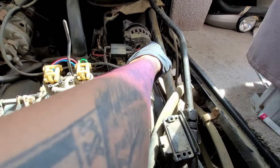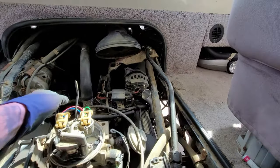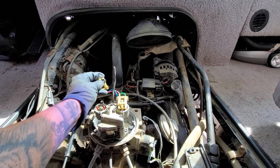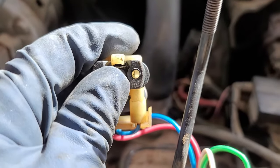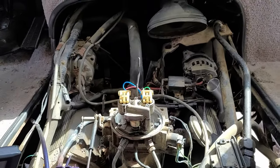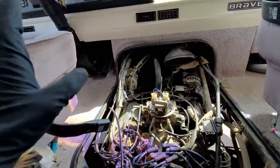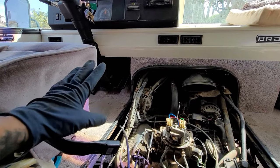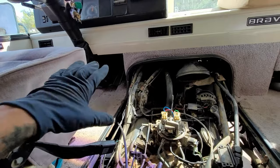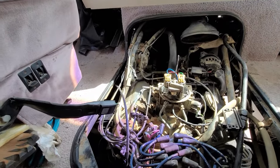What I did was use the signal from the positive terminal of the alternator — I unplugged it and put my test lead right inside to touch that terminal, to make sure I'm getting voltage when cranking. I do get voltage, so the computer is grounding it. All my wires checked out fine — grounds and power. Check B3, B6, or B7 for your ground circuits. It's a pain to test because I've got the chair in the way, the motor right here, and I have to lay in this awkward position.